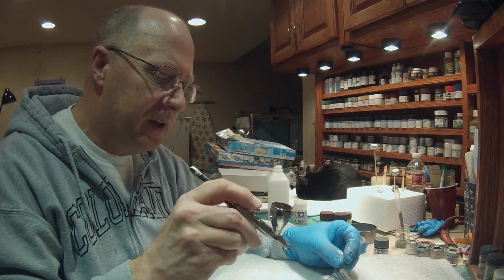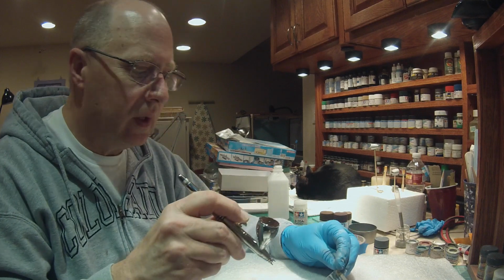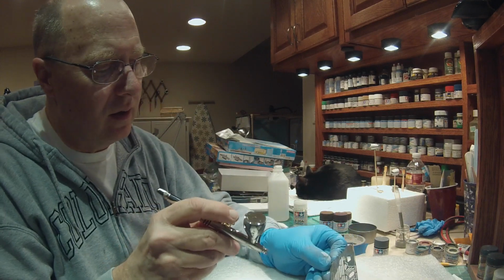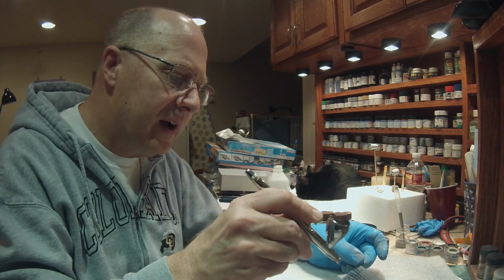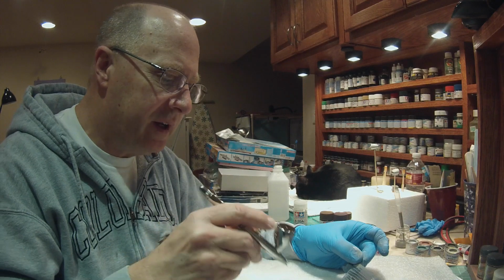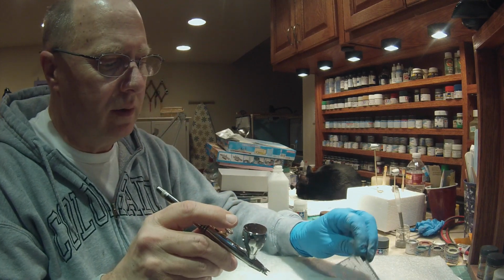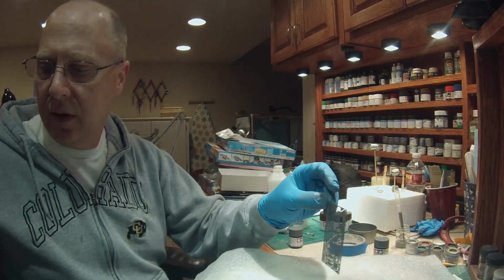We could just switch to air and kind of air dry it before we add our second coat. But I really like to thin it a good 50-50 just to make sure the coat is smooth and thin. Give it a little air dry. We'll put one final coat on here, especially on these big panels. It's all looking very nice. That ought to do it.